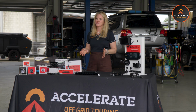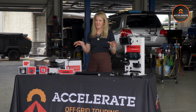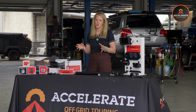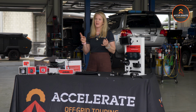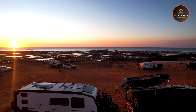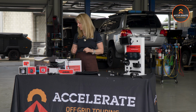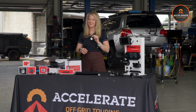All right, so about 12 months ago, Safety Dave released a new range of cameras and screens. These are now AHD, which stands for Analog High Definition. So you're getting basically a better picture quality through from your camera onto your screen. This is better in low vision, so dusk or dawn, at night, and it's just a crisper, nicer image. So the thing to note on this one is that the new cameras don't work with the old screen. So if you've got a new screen, it will still work with your old camera.